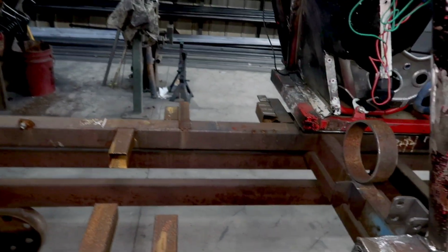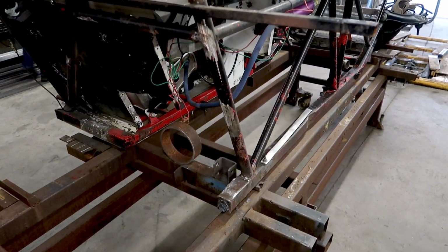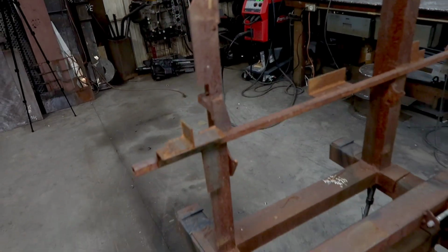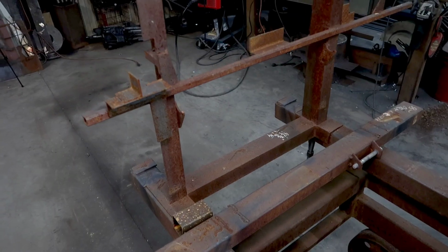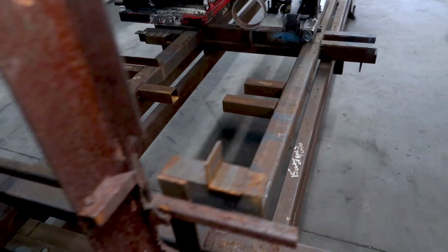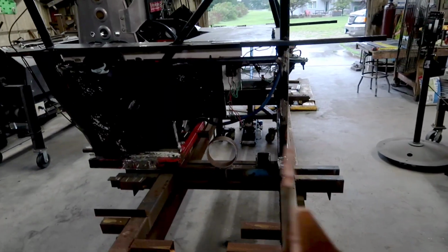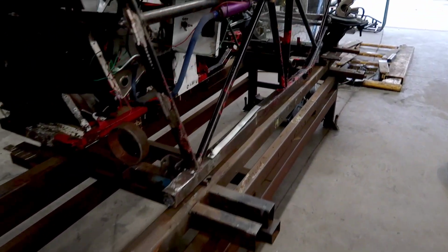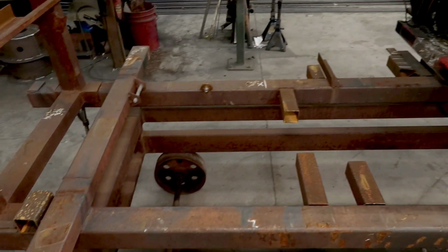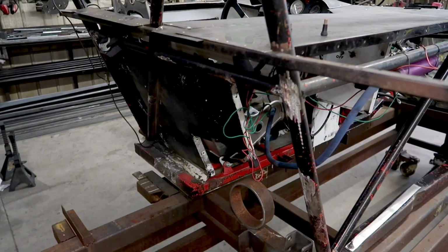Because it's an overslung frame, you gotta make some kind of support. These types of supports are pre-measured. It fits right on the back of the jig, and you can line that up. Because the jig is located by the front lower control arm bolt holes, then you can put on a new rear clip, as they say.